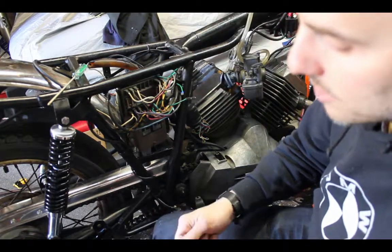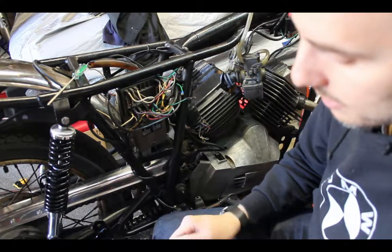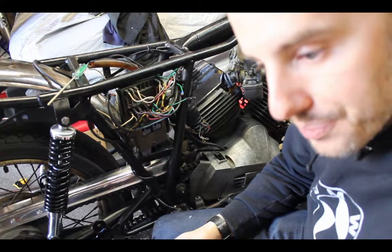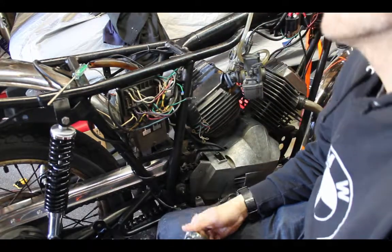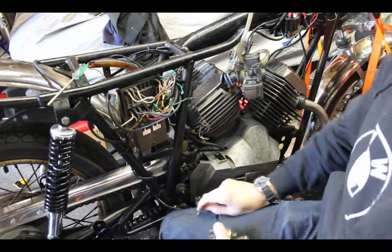Right, so this switch doesn't allow for that, because all of the poles, except for the momentary one, which is the starter motor, are connected when the key switch is on. So I can't actually put my ignition to ground switch in this because I will fry it. So that said, I'm going to put my 12 volts back through this toggle switch.